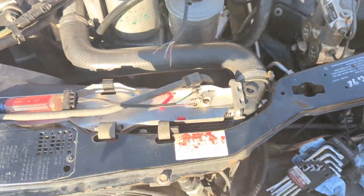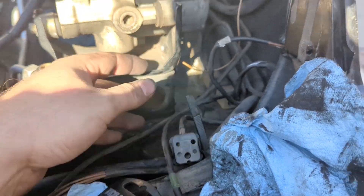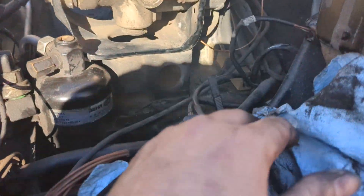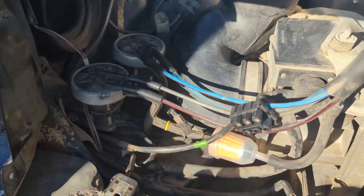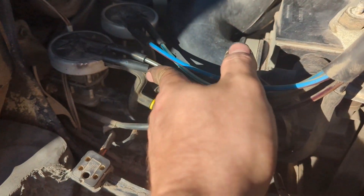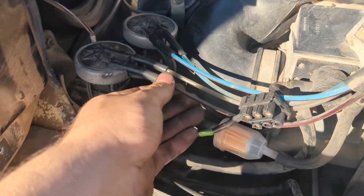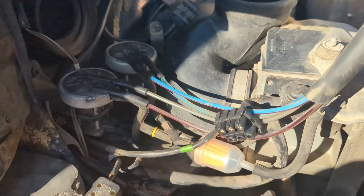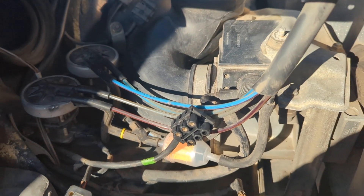Now I can finally get onto this side and rewire this one. When I was fitting this side in I was having a little trouble — this is diesel-specific, but the vacuum lines were getting pushed on by the headlamp and these vacuum connectors were disintegrating. So I got new vacuum connectors on there too. This one is already wired and I did a test — it works good.